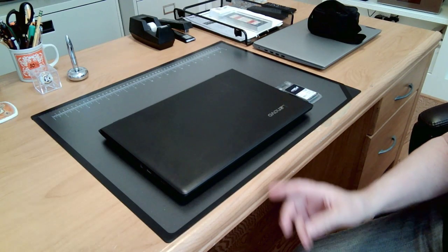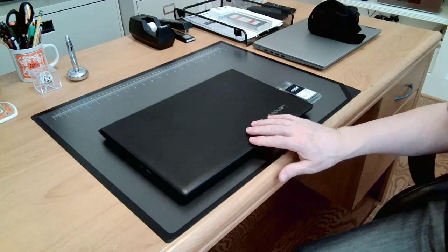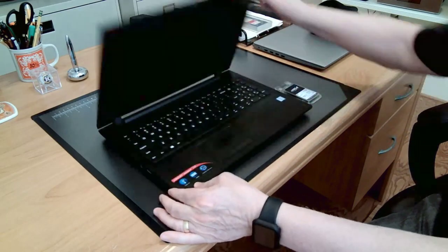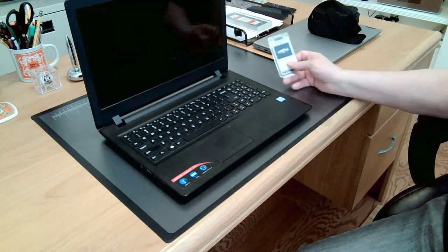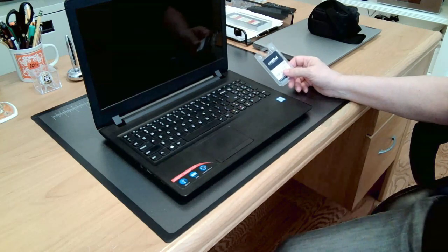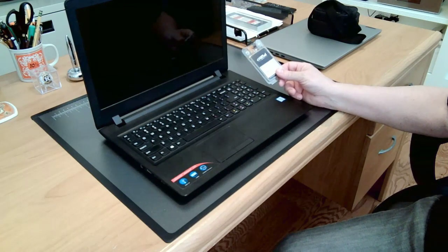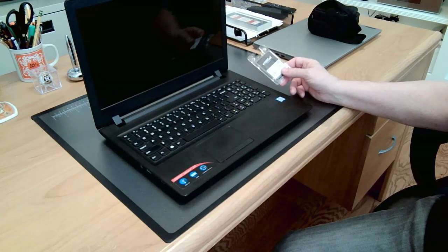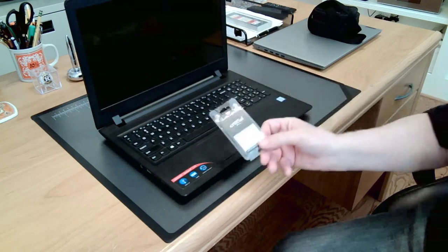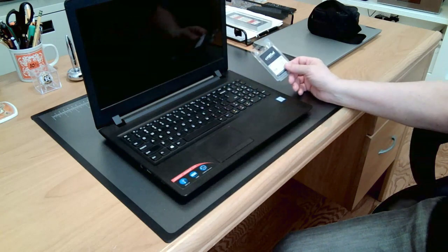Hello everyone, this is Mark. Today we're going to be showing you how to update the RAM in this Lenovo IdeaPad 110 laptop. You can see the model number here. What I've done is I've already replaced the hard drive with a solid state drive, and at that point I probably should have just done this RAM project then, but wanted to see how the computer would perform without doing it. This comes with eight gigabytes of RAM already — four is soldered to the motherboard and another four is in a slot you can change out. So basically I bought this Crucial eight gigabyte RAM stick and I'm going to be putting it in there to upgrade to a total of 12 gigabytes.